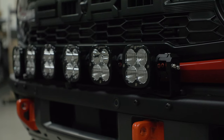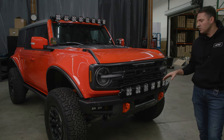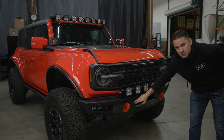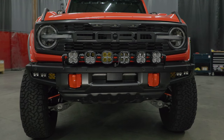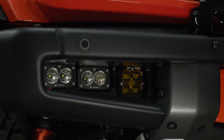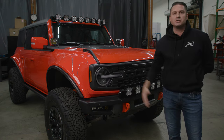This is a Ford factory original Bronco Raptor grille and headlights. It's got the linkable light bar built into the top of the HD modular bumper, with some special painted tow hooks to accent the vehicle paint. The customer wanted to keep that J7 paint scheme all the way down, so we did the hood trim, the lower bumper trim, and also refinished this front skid plate in that same J7 magnetic color code — that way it's all consistent across the front of the vehicle. The HD modular bumper has SAE-approved amber fog lights connected to the factory fog switch, plus outer lights connected to an upfitter switch or Switch Pro.